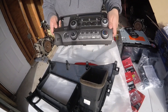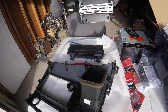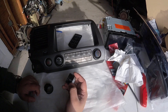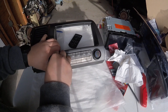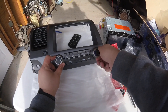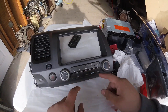To get these buttons off they're a little tricky — you're gonna push really hard on the center of the button and they should just release. It's just a locking mechanism held by pressure. You want to align the grooves: there are three grooves down there you want to match up, and there's a big groove that's the one you want to locate first. Once you find those three grooves you should be good. Here's what that panel looks like once it's done and ready — all your buttons are transferred and it'll work.